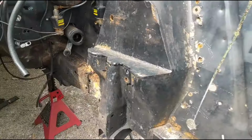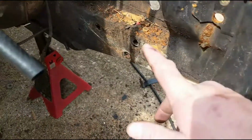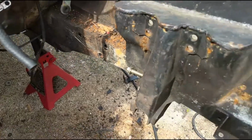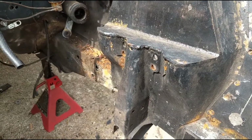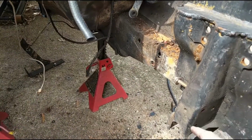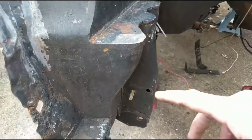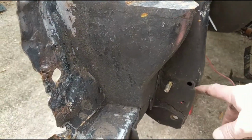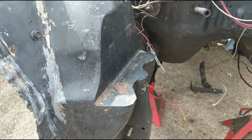And now I went ahead and drilled a 3/4 inch hole here and over here. And we're going to put the big boy blade on the Sawzall. And we'll start cutting and we'll get this out, and then we'll probably have to do a few spot welds just to get this part off at the end, but that's not a big deal. And then we'll do the same thing on this side. We'll just cut along and then we'll have a few spot welds to get this part out. But we'll get to cutting.